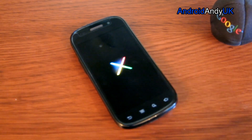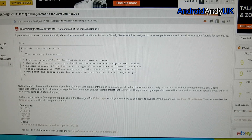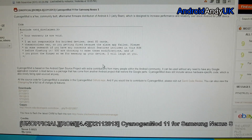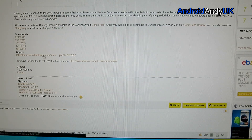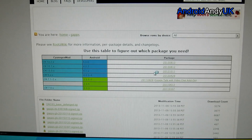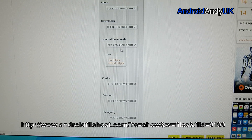Now we've just got to drop two files on there that we need — the ROM itself and GApps, the Google apps. A lot of the bigger ROMs these days, especially like CyanogenMod, aren't allowed to include Google's apps, so you have to install them both separately. So I'm going to get the file itself from XDA Developers — it's the unofficial ROM 4.4, the 22nd of November, CyanogenMod 11 for Samsung Nexus S. I'm also going to need GApps separately, and I'll leave download links in the description of the video.